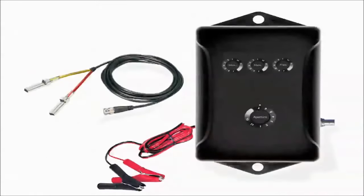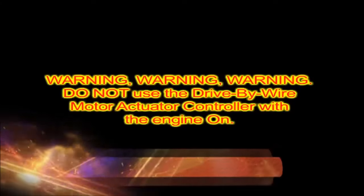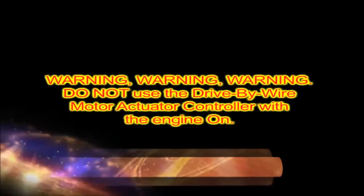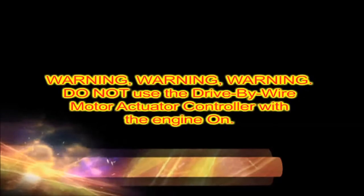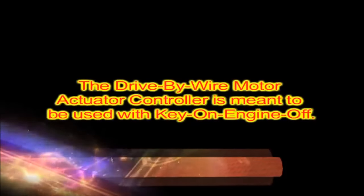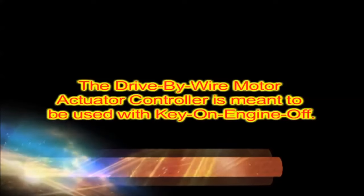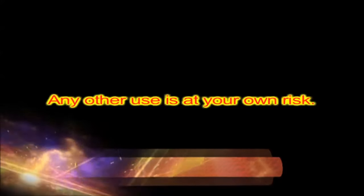Drive-by-wire motor actuator controller. Warning, warning, warning. Do not use the drive-by-wire motor actuator controller with the engine on. The drive-by-wire motor actuator controller is meant to be used with key on, engine off. Any other use is at your own risk.